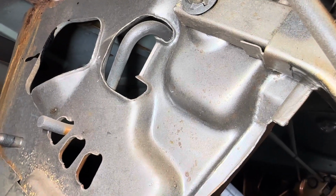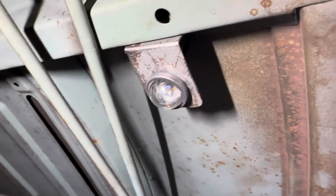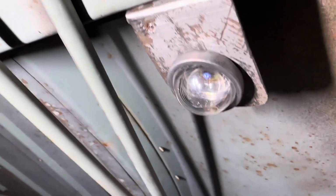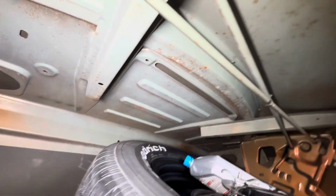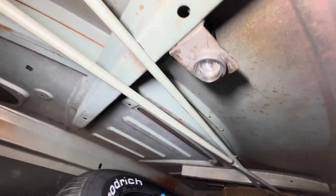This car has had some sort of undercoating, rust preventative, something applied to this trunk. But the underside, there's a trunk light. It's not factory, but if you look at it, you can see the greenish hue primer, all original. This is how you should find vehicles. See, there's a little bit of spray to the back where they shot it in to try to just cover somewhat of the vehicle. But again, this is very common. This is very typical of what the underside of a factory car should be. This was built at St. Louis Assembly. So that is the greenish primer that was used.